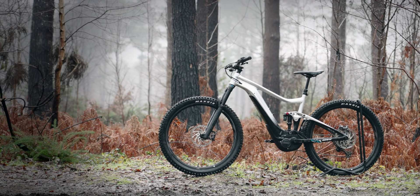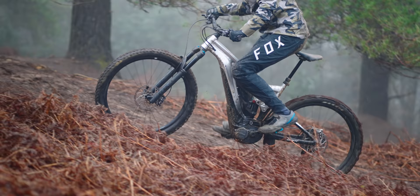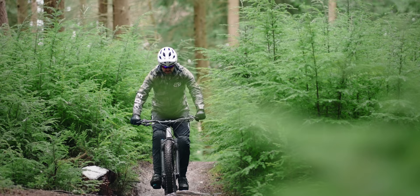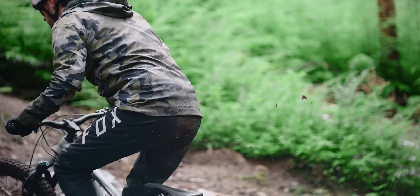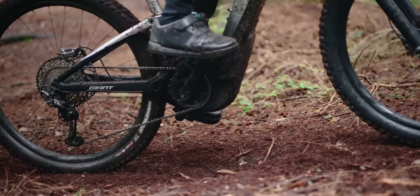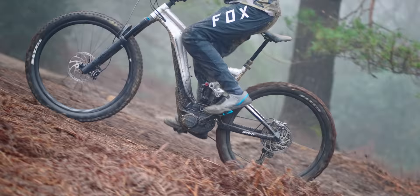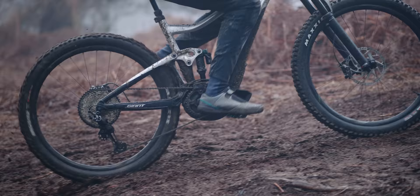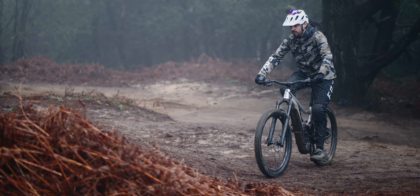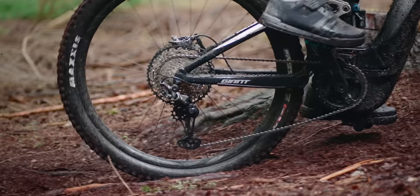Time to test what e-bikes are really masters of: climbing. The bike is powered by the Yamaha PWX2 motor, but Giant have tuned it to make it more powerful. Essentially, Giant have unlocked the full 80Nm of torque in all assistance modes, not just the top one. There's also a smart assist mode — think of it as an automatic mode based on six sensor inputs: riding speed, cadence, motor speed, rider torque, bike incline, and an accelerometer. With all those measurements it determines the level of assistance the rider needs. Giant claim maximum torque is delivered in just 0.19 seconds after detecting the rider's input, and paired with a short engagement angle, it's designed to make starting on steep slopes much easier.